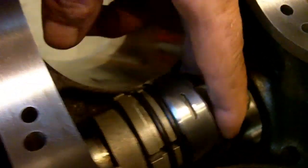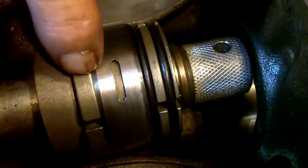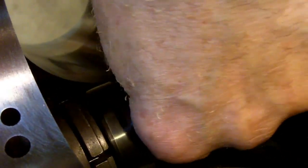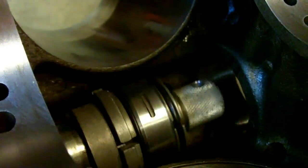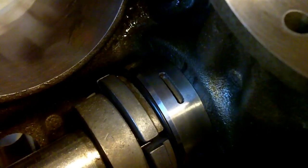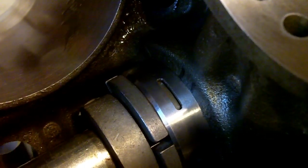You've already sized your rubber rings — there are four of them on there. It hits that ledge at the edge of the cam tool. These bearings are chamfered on both sides, so you can't put them in wrong. You get over here and twist this until the bearing is good and snug. You feel that? You can't really move it — that's what you want. Then you see that slot? We've got it lined up approximately in the middle of the two black marks. Make sure it's seated.